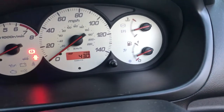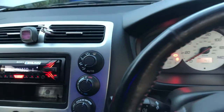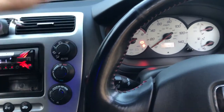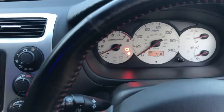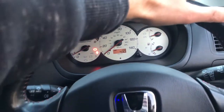We're almost up to temperature. Hot air's just starting to come out now, so we've got most of the air out of the system. Even when you can start to feel warm air coming out of the vents, still leave it running. Ideally, you want to leave it running until the main fan kicks in and you know it's fully up to temperature — just keep topping it up and you should be good.